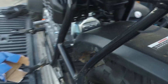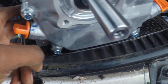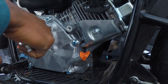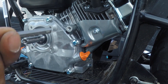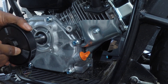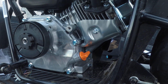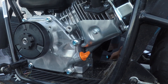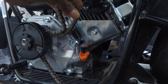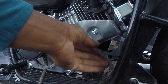Once we drill, we'll be able to get our motor fastened correctly. Slide that clutch onto the shaft, then get your chain and line it up. You want to make sure you have perfect alignment because any misalignment will cause the chain and clutch to wear prematurely - it causes extra heat in the system. This is a very critical step, don't rush it. Take your clutch, slide it on, get your chain on properly.